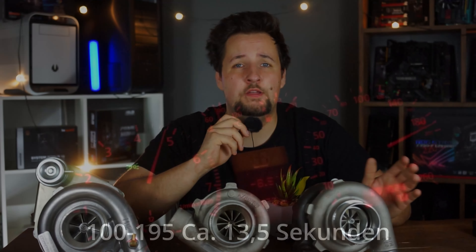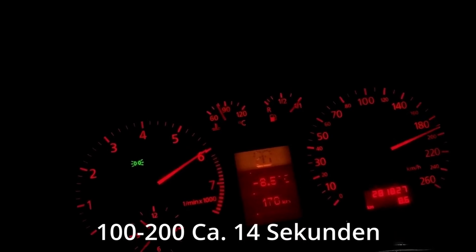But I had some bad things to say as well. I used one for a 180 — a stock K03 or K04 upgrade turbo — which didn't last long at all, like 700 kilometers. The GT28 I used for another 180 had substantial oiling issues after about 2,000 kilometers. But on the other side, I used the TDO4 turbo at 0.8 bar on the MX-5, even without a blow-off valve, and never had issues. That turbo even accidentally ran about half an hour without any oil on it.